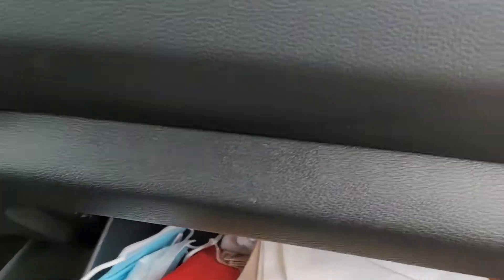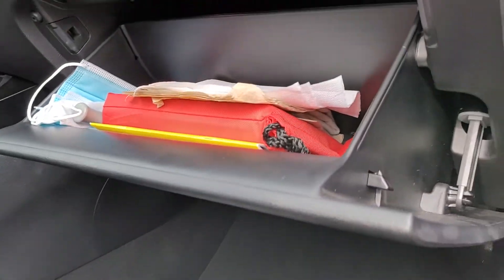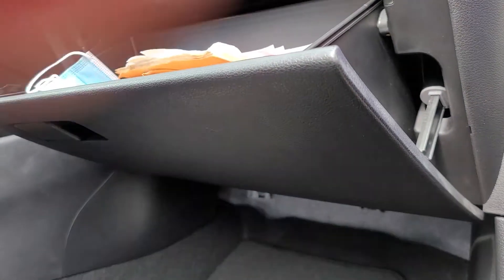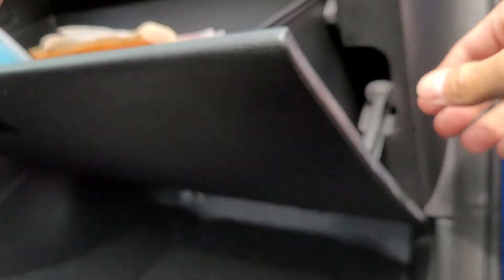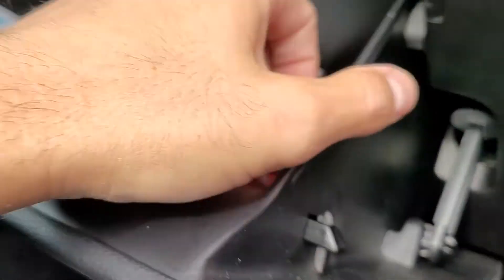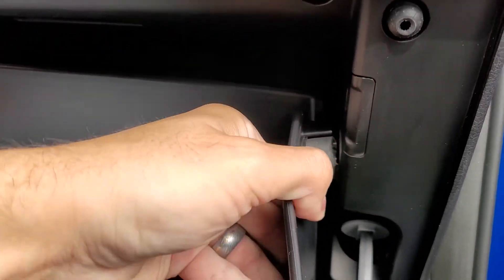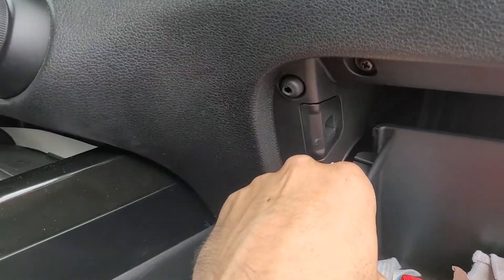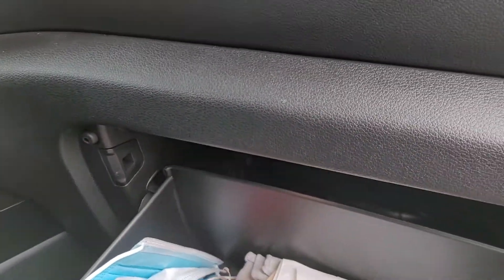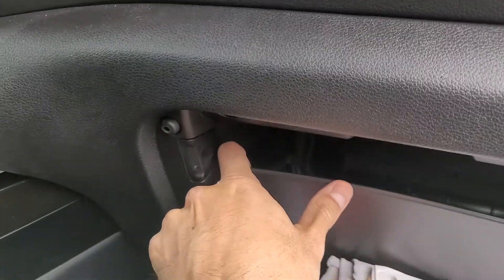Okay, we have the glove box open, and you're going to come to the side here — there's this little tab. You're going to pop in the little pin, hold it together, and pull off this little lever. So that's what it looks like. This is what's going to hold your glove box once you pull these in. So you pull this out a little bit, the other side same thing — pull that back, and this will drop down ever so slightly.